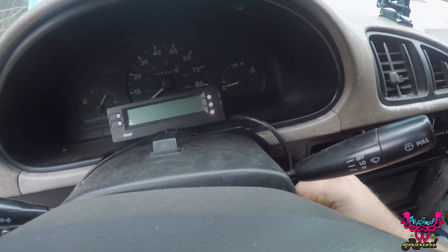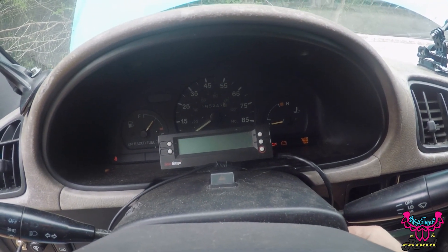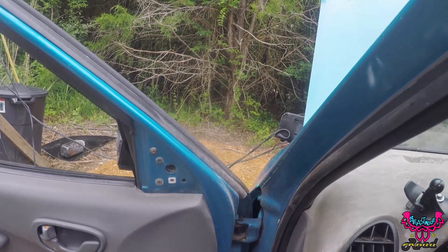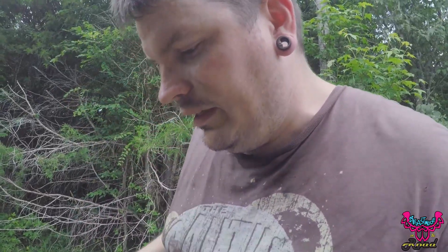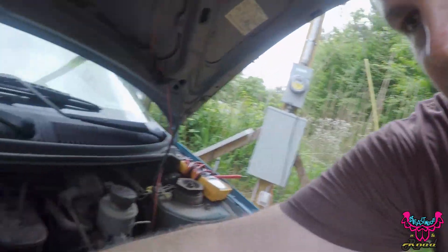Of course my battery's dead. That didn't sound very good. Lots of deliberation and cleaning and going through parts figuring out what could have been wrong - spark plug wire, it was corroded, real corroded. I'm not willing to press the gas right now, I just want to see if it'll idle, because my other problem is it likes to die at a stop sign or in traffic. People say it's the crankshaft position sensor, which could be since it's gotten covered in oil through the last year or two of it leaking.